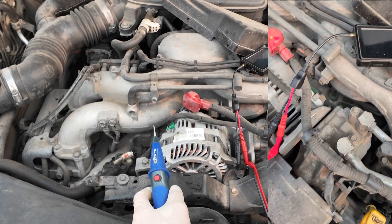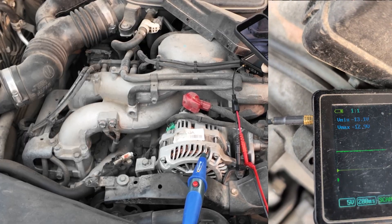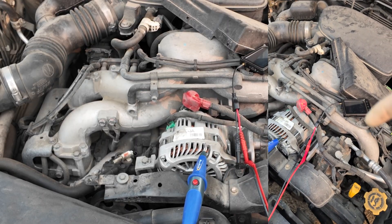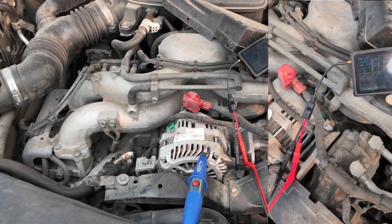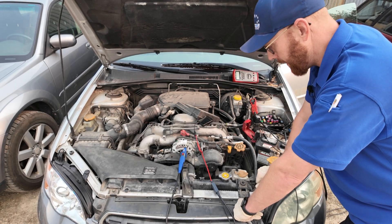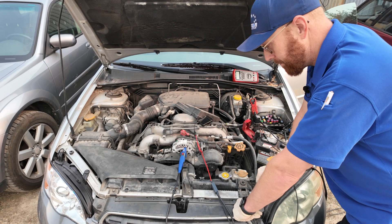That's how you do the voltage drop testing. You don't have to use this scope — I just like it, I think it works really well. It does take a bit more time to set up, and this guy takes batteries so if it's dead, flip it, grab some batteries, and move on. We're going to go over some scope testing and I'll show you the DSO — the digital storage oscilloscope — and where that could come in handy versus something like this, which gives you a live reading but no ability to save and re-examine. All right guys, I hope this helped. Get off your phone, figure this stuff out — it's really not all that hard. See you next time.